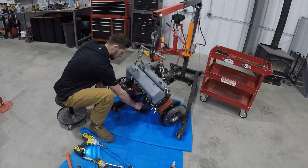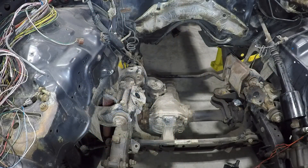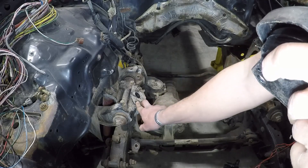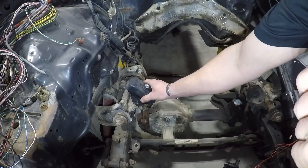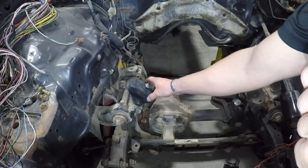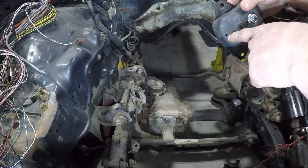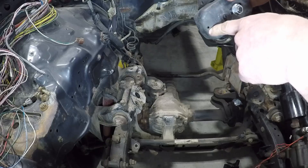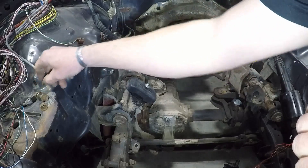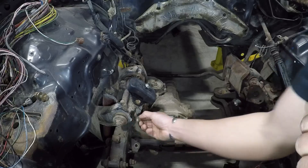This nut here on the rubber isolator is usually going to be an 18mm. When we look in the engine bay, we'll see we have these motor mount perches coming off the frame rails — that's where these rubber isolators sit. This dowel pin goes to the bottom. You'll also notice on the steel cap there's a hole in the bottom of it — that hole goes to the bottom. That sits on there. Then you have a bolt that goes through the top and a nut on the back side.